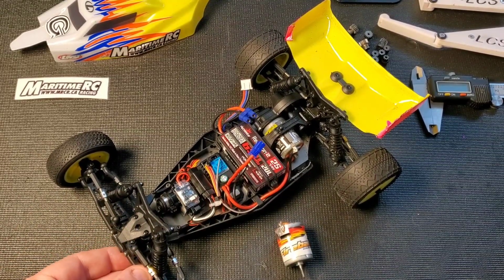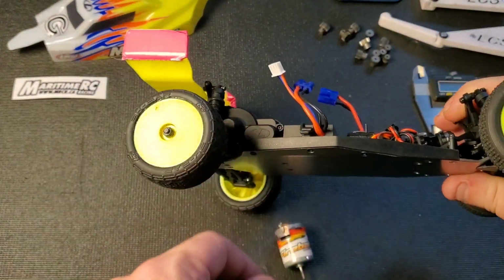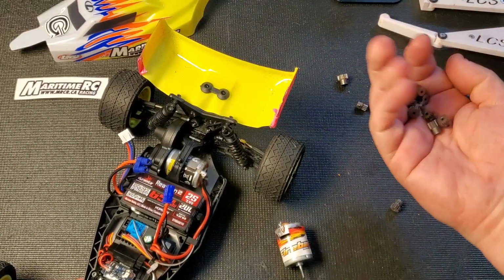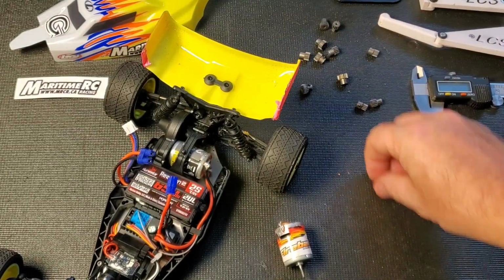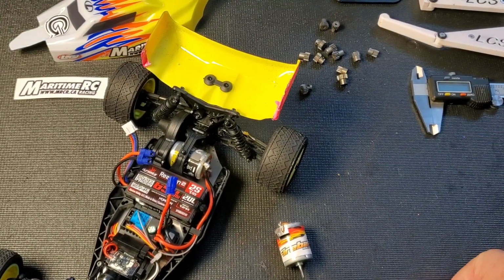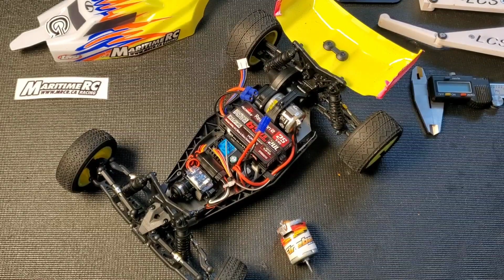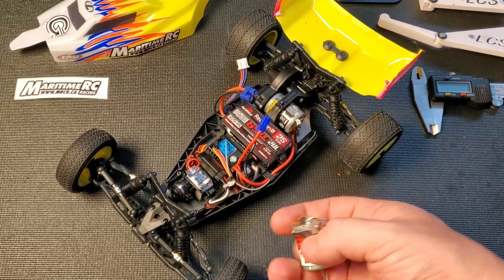So what we're going to do for the next video is I've ordered in one of the sliding motor mounts. So then we'll be able to adjust gearing. Right, I got lots of gears. That's not the issue here. The issue was that the motor mount's not adjustable. So we've got one ordered. We'll be able to change the gearing to tune for the RPM of the motor.